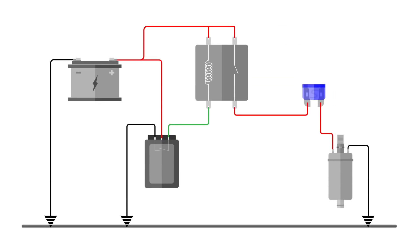An important issue to be aware of when designing the power supply scheme is that of ECU back feeding. Because of the way ECUs are constructed internally, it's sometimes possible for them to connect their output channels to ground when the power supply to the ECU is removed. This can cause problems for actuators connected on one side to 12 volt power and an ECU output channel on the other.